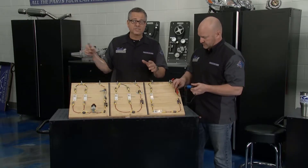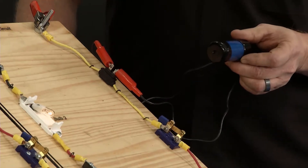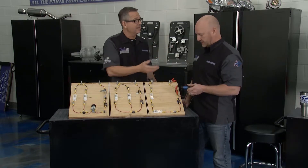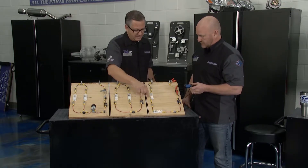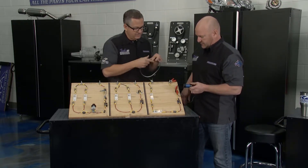But when I simulate the short this time and go back to ground, what's going to happen is inside of here is a circuit breaker. A circuit breaker is in cars all over — seat motors, window motors — just like the one in your house. Something gets hot, it trips. This one's resettable though, so it keeps trying to reset. Until he finds that short and gets it off the metal, it's going to keep buzzing and keep shorting.